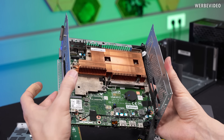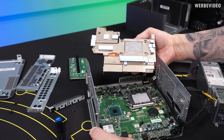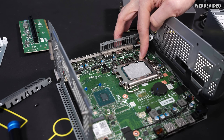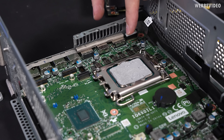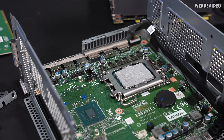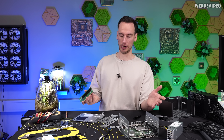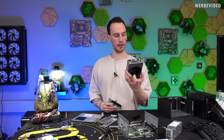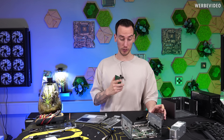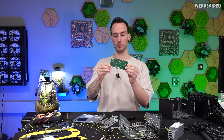You can see they definitely put some thought into this PC — a lot of custom PCB work. There was plenty of thermal paste with good imprint coverage, and thermal pads as well. I'll definitely replace the thermal paste. I also thought about putting a contact frame in, but realized it won't be possible because they used the ILM simultaneously to fix both the CPU and the heatsink — the heatsink screws directly into the ILM, which is an interesting design but makes changes difficult. While researching I also found there's an RTX 4070 version of this, but only available in China. Maybe in the future I can find a GPU of the same size, as this looks like a pretty standard RTX 4060 footprint in terms of length. That riser PCB also handles the PCIe connection to the card and the M.2 on the back side.